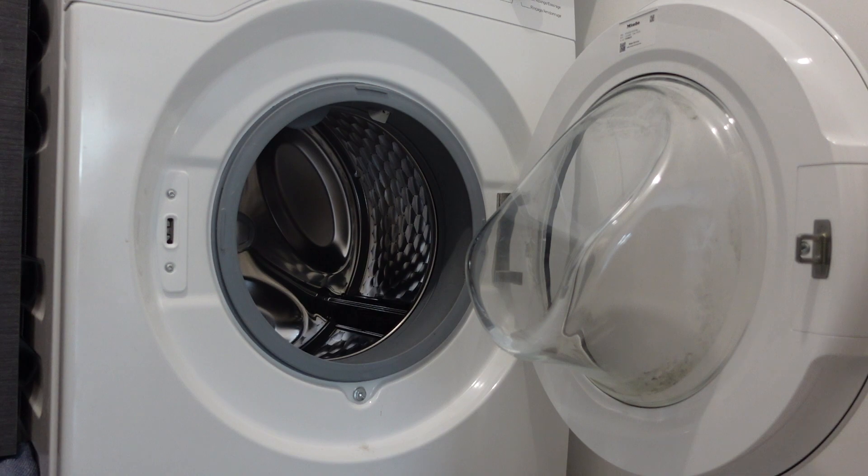Basically it kind of guesses at the beginning, and then depending on how much clothes you are putting in there, how heavy that stuff is, the type of fabric and the amount of water those fabrics can absorb, how sudsy your water gets, how cold the water is going to the machine so that it takes longer to heat up — all of that can affect the time. Even the type of fabric can hold water longer so it has to spin more to get the water out.